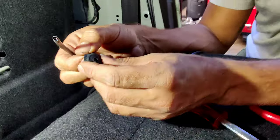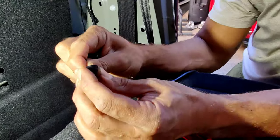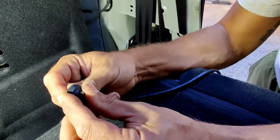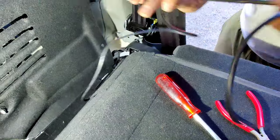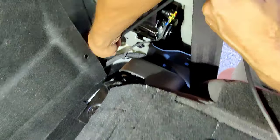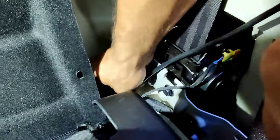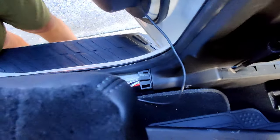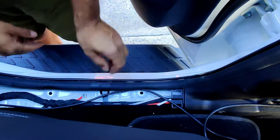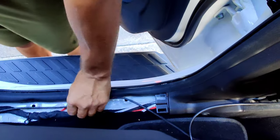So now we've pre-drilled this hole. I'm going to feed this cable through — very tight — feed it through just like that. We're going to plug this hole back with it, nice and sealed. Then we're going to feed this cable down here, go underneath this and down here, and then we're going to pick up the CDL feed for this rear left door. So let's get that going.